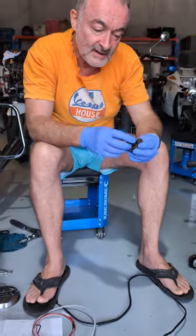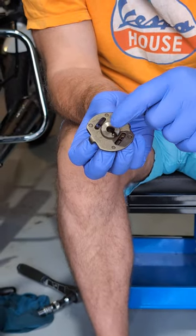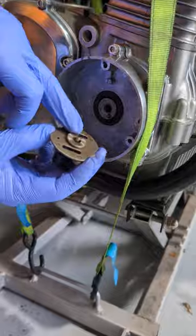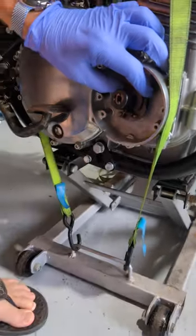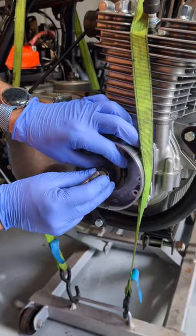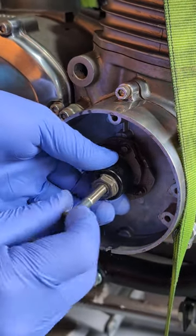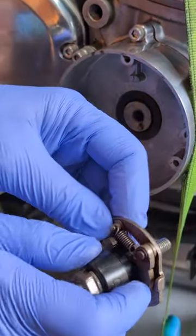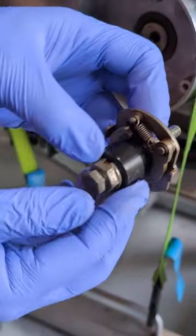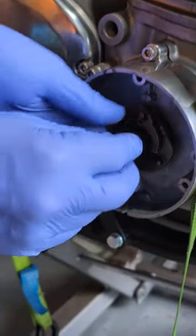Next, this needs to go back on the bike. We use that dowel pin I mentioned earlier and use that slot to align this on the back of the dowel pin right here — you can see it will just slot in there. And then this whole assembly uses the stock nut and washer right over the top. The OE bolt fits right the way through. So let me show you the assembly before I fit it — you can see that spring-loaded mechanism opens and closes, held in with the special nut and bolt, and this whole assembly goes onto the output gear here.